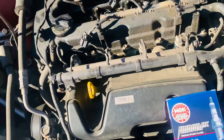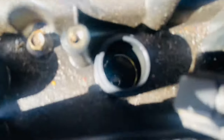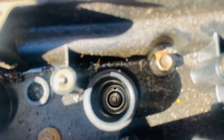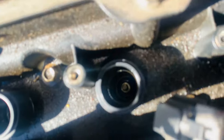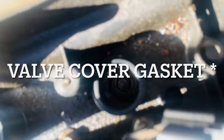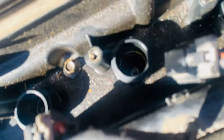I've got all the coil packs out and I want to show you guys something. Whenever you look in here, you see the spark plugs. Whenever it looks clean like that — there's a little bit of dirt but no oil in there — you know that those cylinders are good. But this one has some oil in there. You can see a little bit of moisture, a little sparkliness in there. That's how you know you need a seal at the top of the engine. It looks like it's cylinder three where it's leaking a little bit of oil on the spark plug, which could mess it up. Still going to replace them, but I know she needs to get that seal replaced.